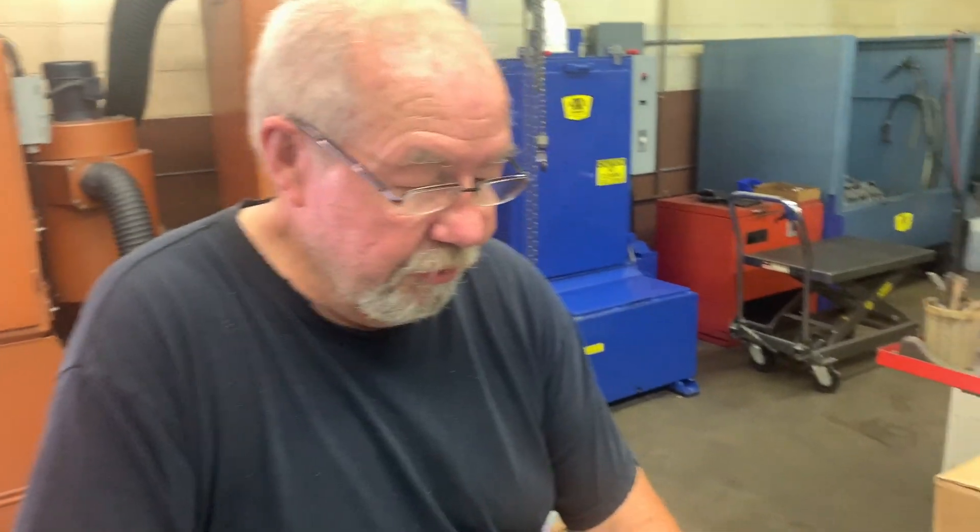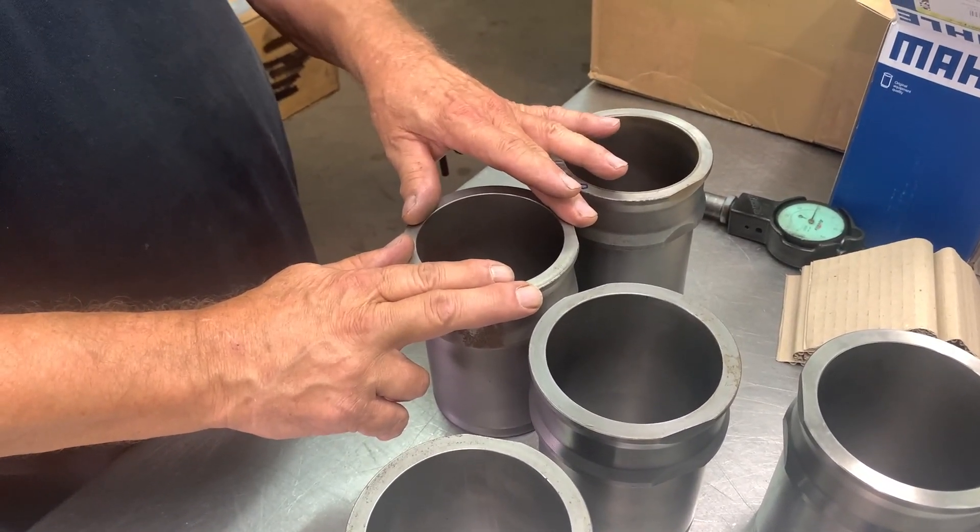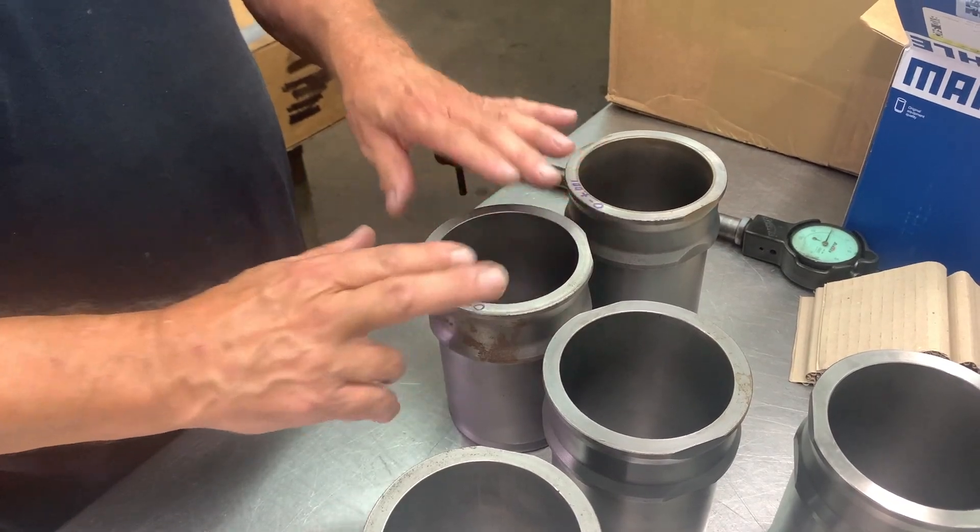What size are we going with? What's our final bore size? Well, let's take one that's a half a thousandth tapering out around, or let's say it's got one thousandth tapering. In order to get that straight and round, I'm probably going to need two and a half thousandths of material to work with. As long as these are in the spec of the manufacturer, could we just put a finish hone on them and use them? — You probably could. It's hard to say what happens when you put them in the block and tighten them down. — What about the good old fashioned brush hone? — That'll work too. Just a dingleberry hone.